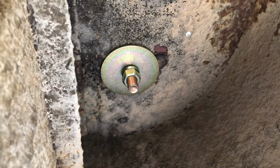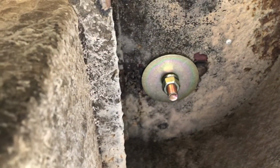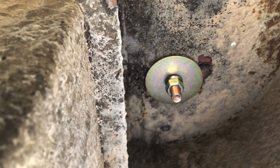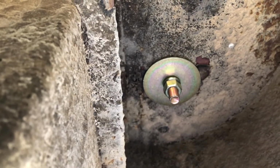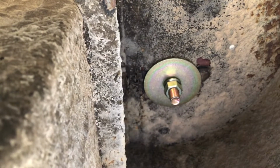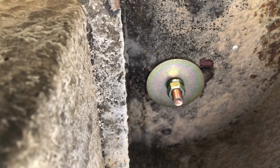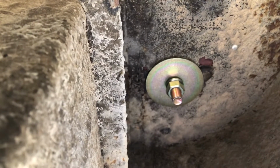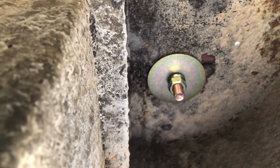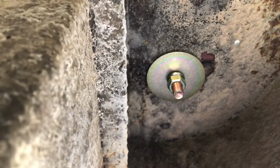Didn't stop recording. Okay, so there it is. Just ran that up by hand. That leaves the bracket loose at the top, so you can position the retractor where it's going to work out best for you. I'm going to spin the retractor around, make sure it's where I want it, and then we're going to feed the short belt through the retractor into the L bracket and get that in position. We'll leave all the hardware loose until we're done, and then come back in and wrench it all down good and tight.